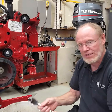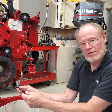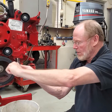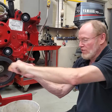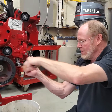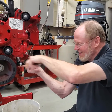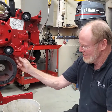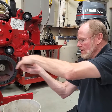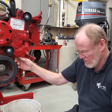If this is the first time you're taking this off, you should be able to reach in here, even with the heat exchanger, with maybe a six-inch extension, and pop that fitting loose. First time this has been off, so there's probably a little bit of antifreeze in here.